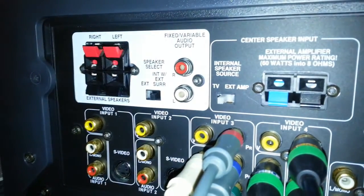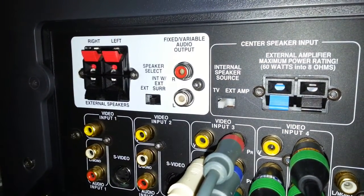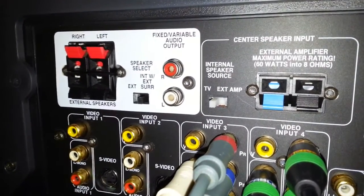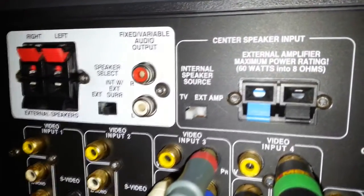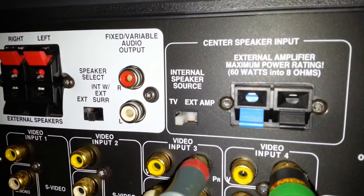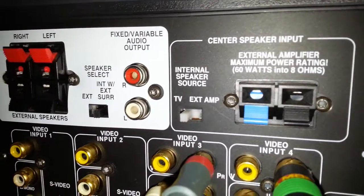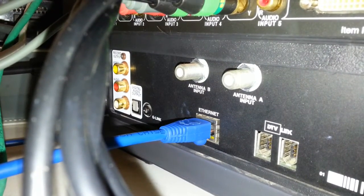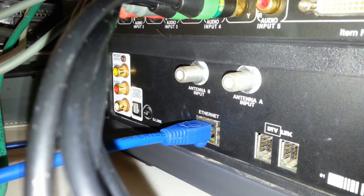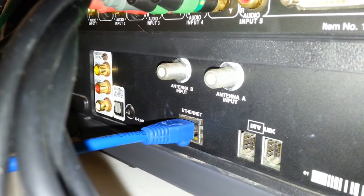On top of that, we have some handy audio I/O, and actually pretty fancy stuff for a standard TV set. It has external speaker outputs, standard line-level outputs, and a center speaker input. So if your sound is all run through a surround sound system and you want to use the television set's built-in speakers as your center speaker, instead of trying to balance a center speaker on top of the set, you can just plug the audio leads into here. On the bottom, we have composite video output, digital audio output, two standard coaxial inputs, one of which includes an ATSC and QAM tuner. And then underneath those, we have some of the connectivity that represents the basis for some of the set's more interesting features.